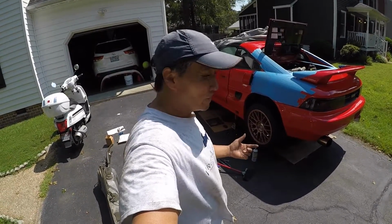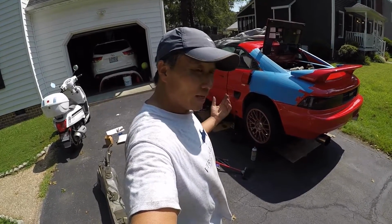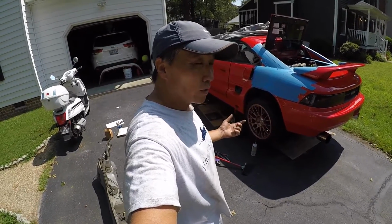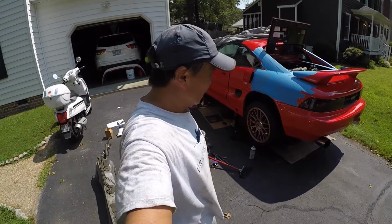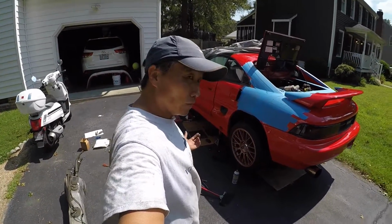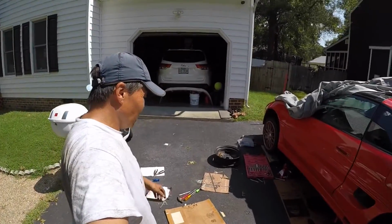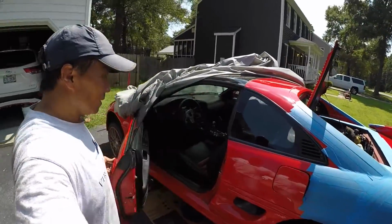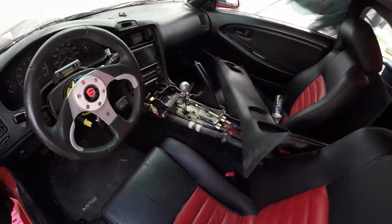When I pulled off, I tried to restart it. But as time went on, I couldn't even get it working. It would start up, but it would shut off immediately. So my inclination was, I need to replace the fuel pump. But yeah, what a job. I just got the tank dropped today. There's my inside. What a view.